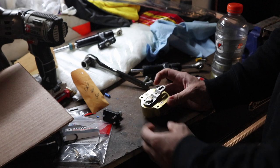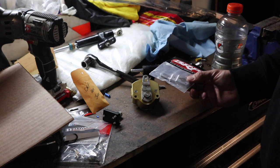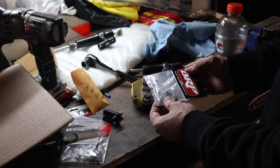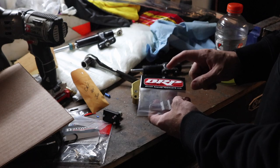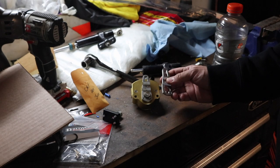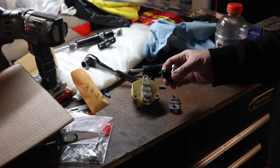On a 790 or 890 you have to purchase a different arm — you need the plus 8 millimeter arm, which is a little bit longer and allows us to reach out and grab the tower pin we just installed. Big shout out to the guys at BRP — they got this here in about three days. This piece is about 48 bucks, so if you don't already have it plan on spending that. If you buy the entire kit, some kits come with this size arm.